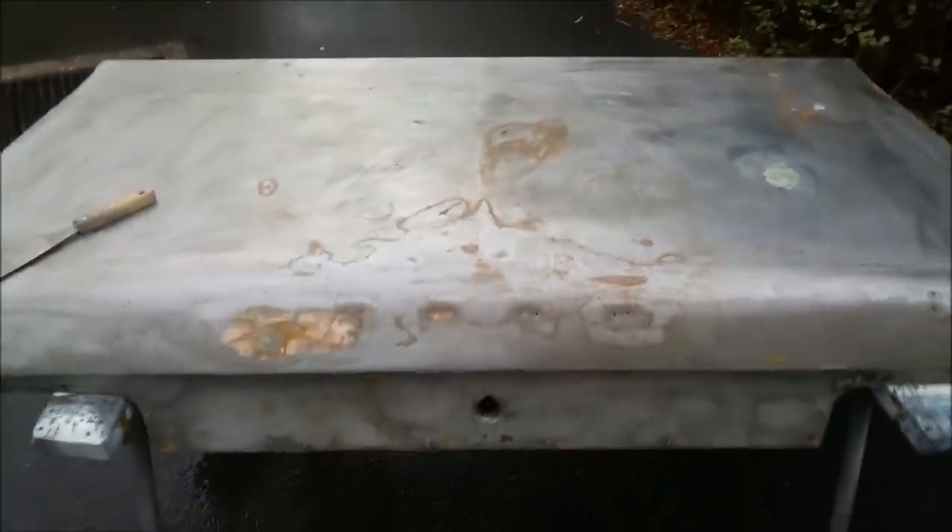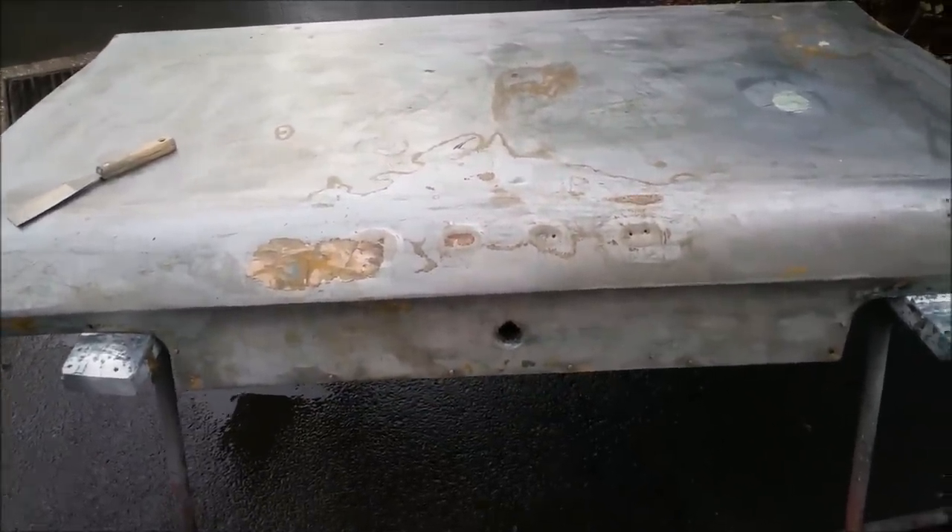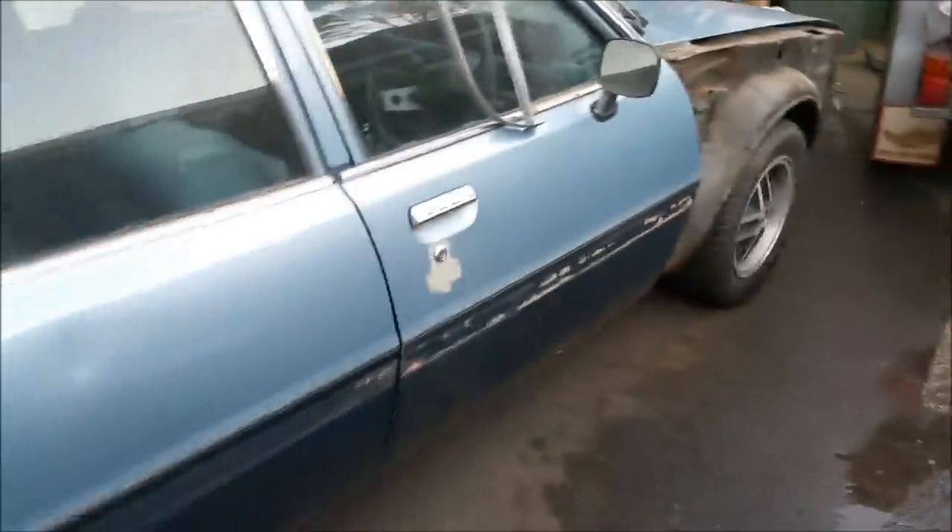It's not great - surface rust around where filler was. I couldn't get some of the filler out - strip won't do that. You can see there's badge holes there. What they've done is they've pounded the edge of the badge hole in - you can see the hammer marks there - seam sealer on the back and then just filled over them. Same with the FMRD badges there. Not the right way to do it, but it didn't show through. Now we've got to weld these up properly. I'm waiting on a GXL badge so I'll know exactly where the holes need to be. If you're new to the channel and you're into Sigmas - the Sigma is a big job, but it's a bit cookies and cream - there's nothing too difficult about it. This car is your full roast dinner - everything from the engine down to clips, brand new or reconditioned. Anyway, hope you've enjoyed this - take good care of yourselves, I'll see you later. Bye.